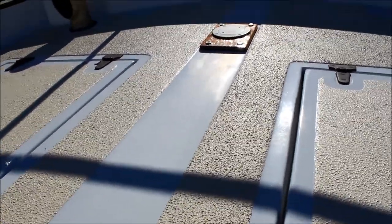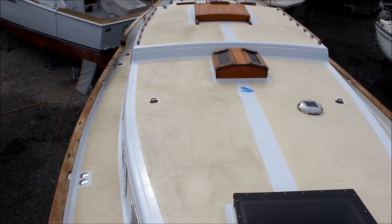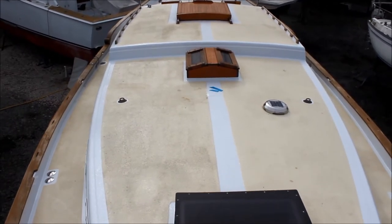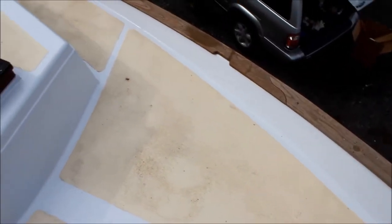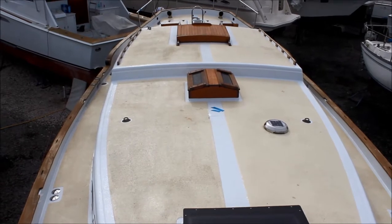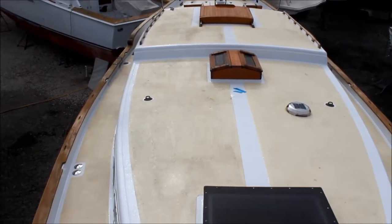The issue is, as I'm sitting here in the boat yard, boats come next to me, get their bottoms or tops sanded down, and all the dust collapses on top of my boat. So if it's black bottom paint, it'll show up in the little tiny microscopic grooves I've carved into the paint due to the abrasive pads. I've learned that lesson, and I hope to teach others — if you paint your deck with Kiwi Grip or Interlux Perfection or something like that, be sure you use the right tool to clean it, otherwise you can be facing some consequences. I struggled with deciding if I was going to put another coat of paint on to mask up all that damage, but I realized over time it really isn't that bad. At this angle it probably looks just fine. The paint's holding up and I think it'll be all right.